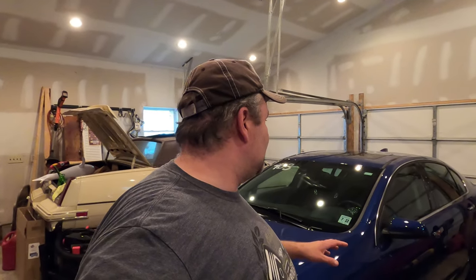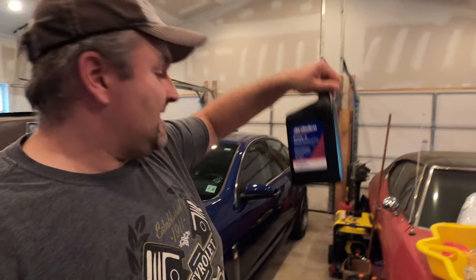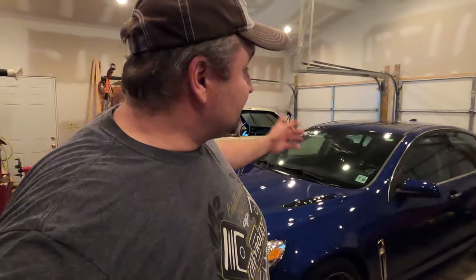Basically what you have to do — I'll go through the procedure in more detail — but ultimately I'm gonna get the car up off the ground, make sure it's level, fire it up, and I'm gonna have my laptop hooked into it. I gotta reflash the gauge, it's acting a little stupid, just need to do an update. I'm gonna start a log and wait until it's between 86 and 122 degrees Fahrenheit, have it in gear, open up the plug, let it drain out. Once it starts to just barely drip, I'll put the plug back in, clean everything up, and put in another quart and a half of standard Dexron ATF — that's what I've been using.